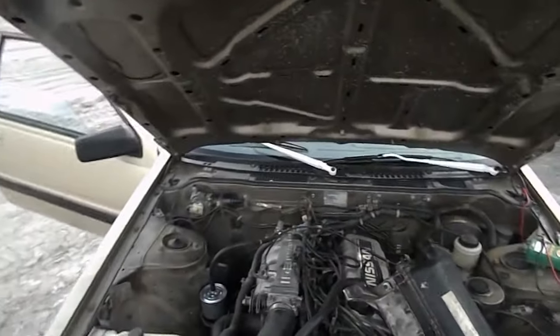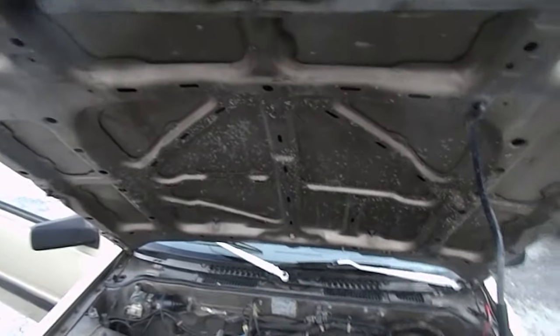I'm still getting fuel. I get spark on the exhaust side, not on the intake side, so at least it's something I believe I can fix easily, so I'm not too bummed about it or anything. So that should be hopefully an easy fix. She's on the phone right now with AutoZone ordering the part. And then after that, I'll let you guys know if that fixes it.